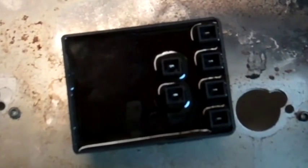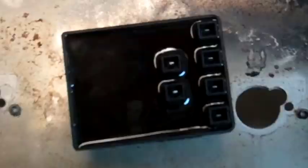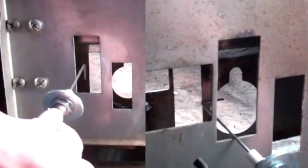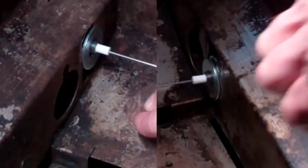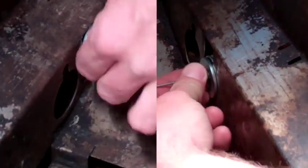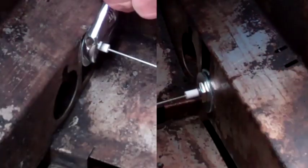With a six outlet module, we can add all new ignition electrodes. Because of the large firewall opening, we're using a threaded electrode with oversized washers. Placing a washer on either side of the grill firewall, the igniter is tightly attached to the wall right next to the burner. These electrodes have an extra-long steel tip that can be easily bent or clipped to set and adjust the gap to spark strongly against the iron burner.